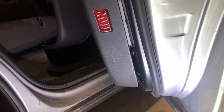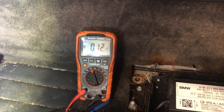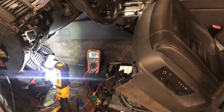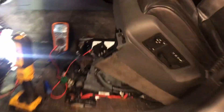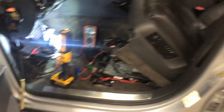I'll do this other door as well and put the door panels back on. With both sides apart, we're jumping around from 90 milliamps to 120 milliamps. If that doesn't solve your issue, this is a good time to mention — you should have probably scanned the car before we started this. I had a pile of codes, but a lot of it had to do with the dead battery. I reset and cleared the codes, checked again, and nothing really came up.